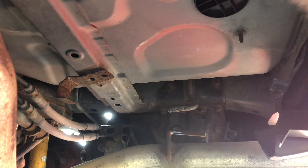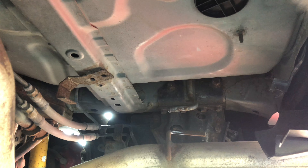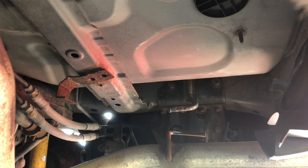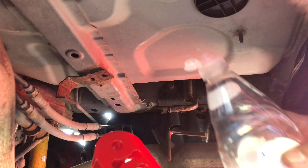Alright, so I got some tools. I'm going to replace the exhaust mounts — I got these Grimmspeed ones, hopefully they'll work. I didn't check fitment or anything because all the ones for the Evo 10 are like five-piece and like 60 bucks. I picked these up for about 20 dollars plus shipping. We're gonna take the old mounts off, put some dish soap on these to try to get them to slip on easier, and we got a variety of things that may or may not help getting the old ones off and the new ones on.